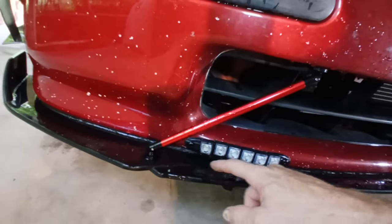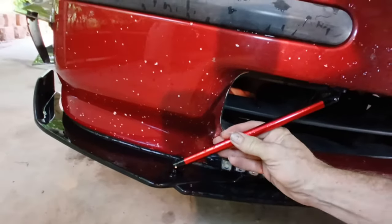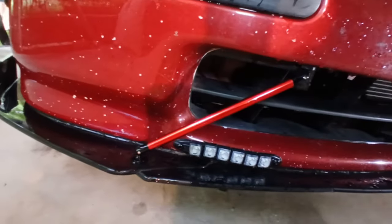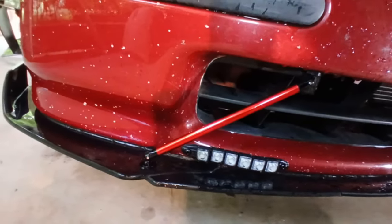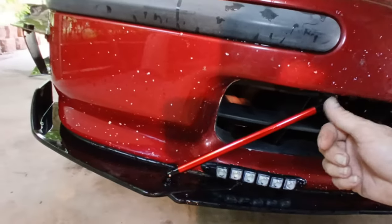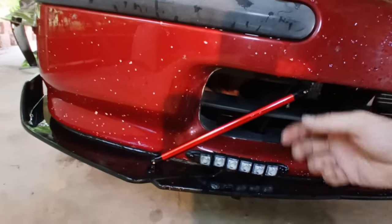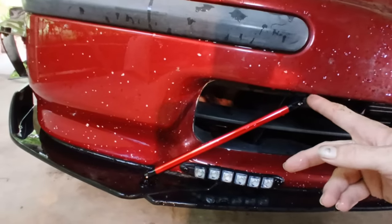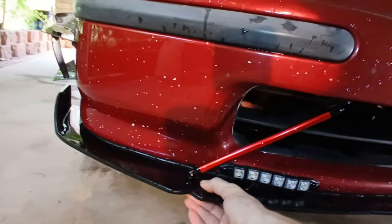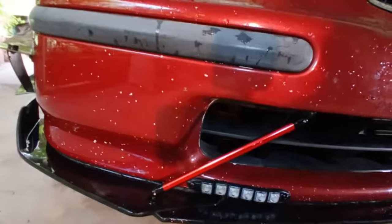There is thicker tape in between here, and these aren't exactly adjustable, even though they were stated as adjustable in the description from where I bought them. But anyway, all I did was find a decent spot for them to mount to on the bar itself, and then adjusted an extra probably 5 mil just to be able to lift that up and support it the way they're intended to support the splitters or diffusers.